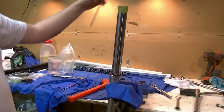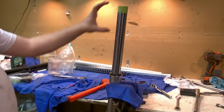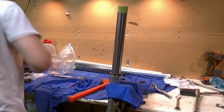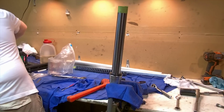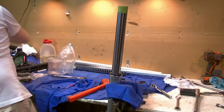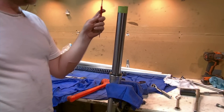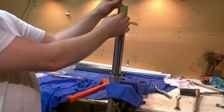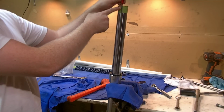That's perfectly fine. They sell tools that are essentially a little vacuum or a syringe, which has a stiff, hard rod at the end there, which you would measure off. Motion Pro in particular makes one. I'll show you there, but it's a rigid rod. It's hollow, it's a tube, and it has markings on it from the Motion Pro one. It's pre-measured for you with a little retaining clip, so it's very slick because it'll hold it in place.